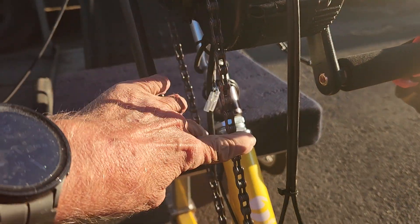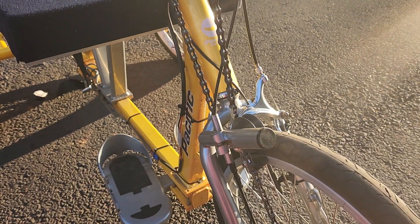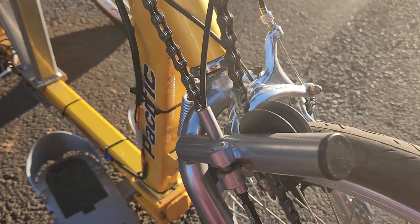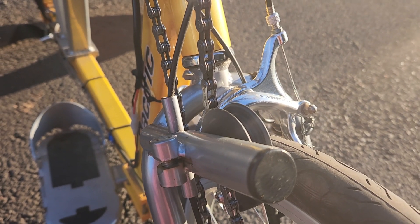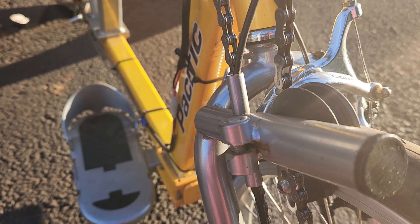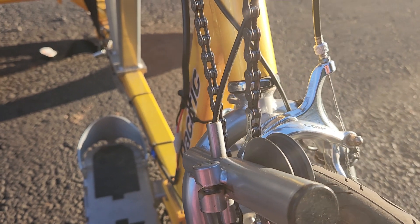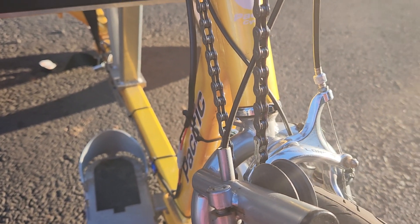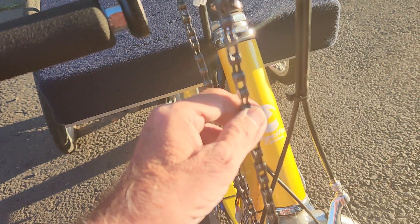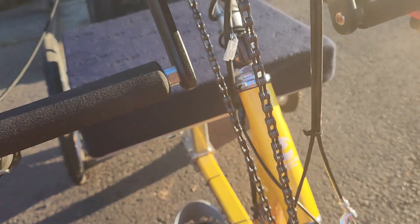I installed two new chains — this is two chains together. It took a couple of tries to get the right number of links; I was a little long on the first try so I took two links out. Then I used a chain tensioner — you loosen a set bolt and you can push it forward or pull it back. I loosened it so it had no effect on the chain, put the chain back together, then tapped it into place and tightened the set screw down for what I think is reasonable tension with a little bit of slack.